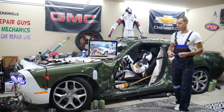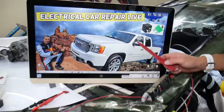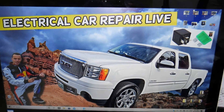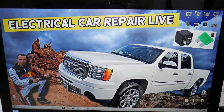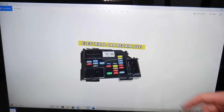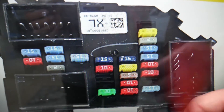So let's go ahead and start. For the right window fuses, we'll demonstrate on this generation GMC Sierra right here. You will have multiple fuse boxes in that GMC Sierra, but today we're working with two, and both of them are actually on the driver's side. Open the door, and here on the side of the dash you have a cover — open that cover and underneath you'll find the main interior fuse box. We have a layout that will look like this one here.